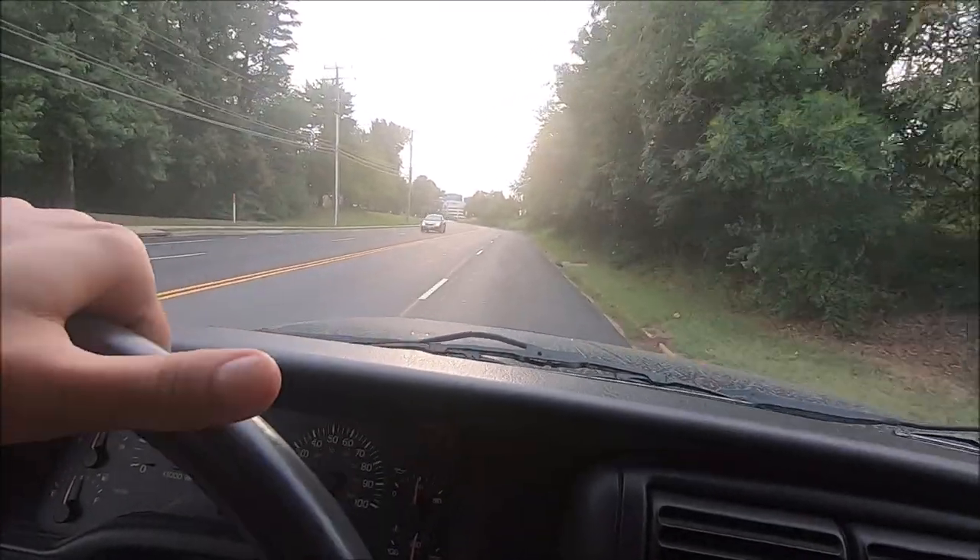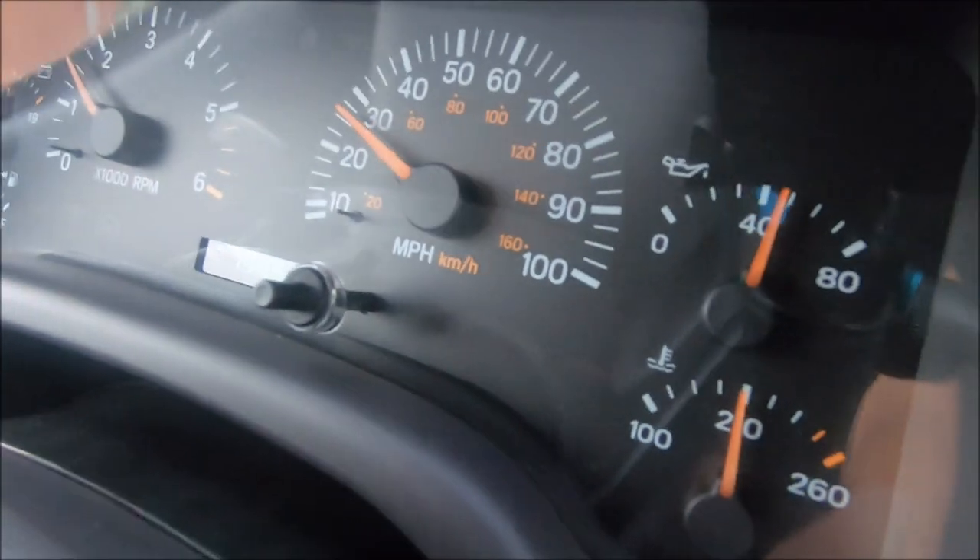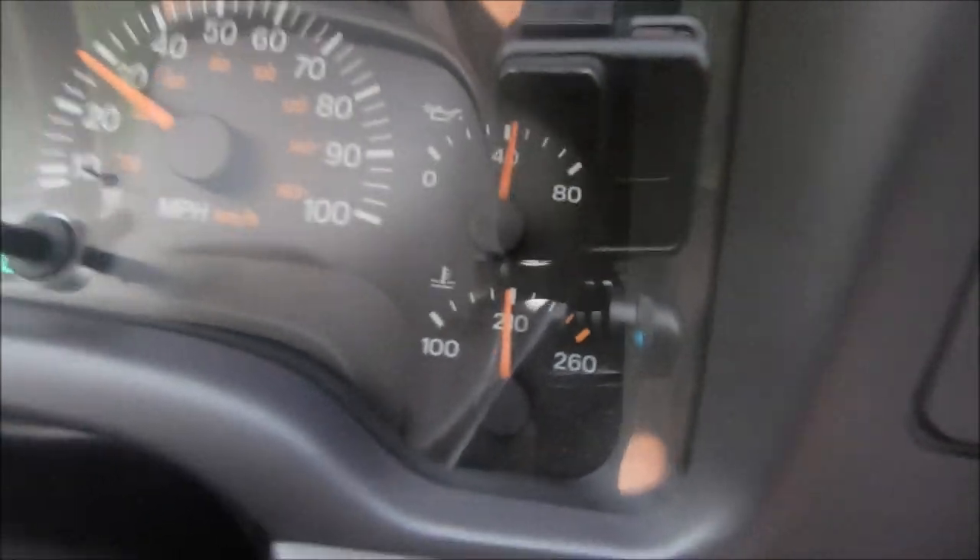We'll see if sitting here longer gets the fan to turn on, but probably not because of all those new cooling parts — it's just not going to require the electric fan as much. It's sitting right at 210 after about two minutes with no issues. As soon as we get back on the road you can see the temperature drops pretty quickly. I can visibly see it dropping right now — it's going down even more, sitting right below 210, which is exactly how it should be.